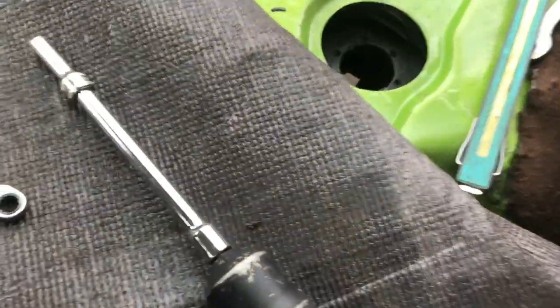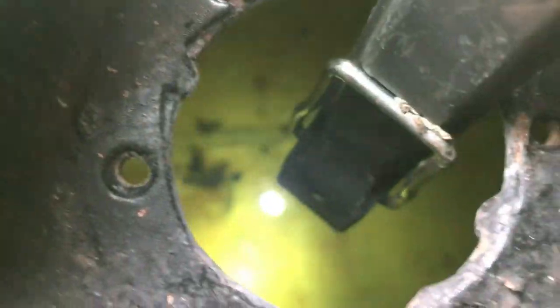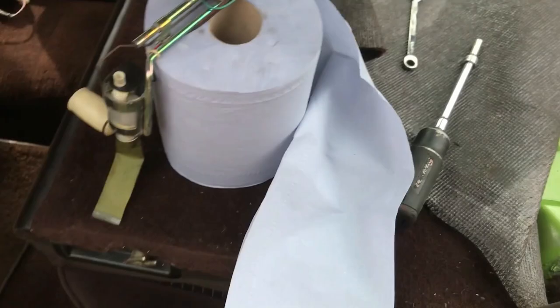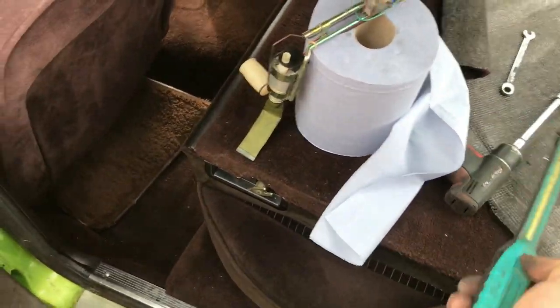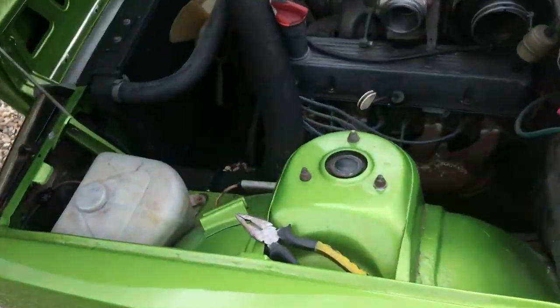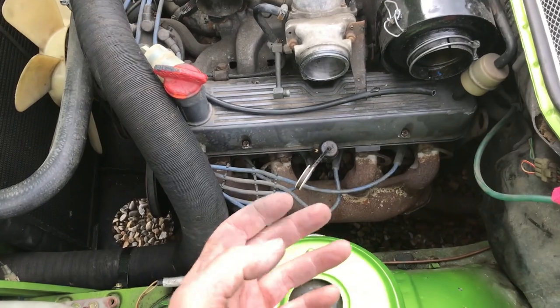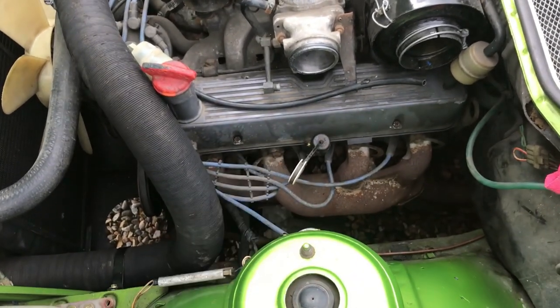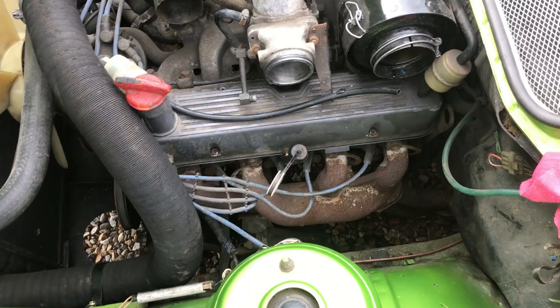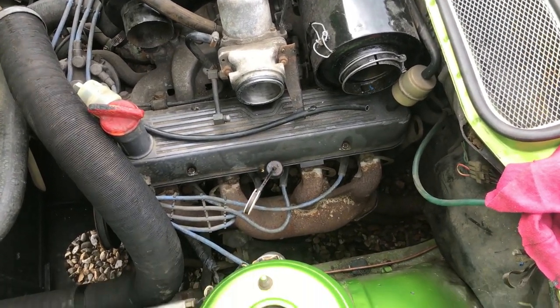If you've watched these videos before, this tank was completely flushed and cleaned out, but it was badly rusty. When my mate just pumped fuel out into the engine bay side, we put it into a little bucket and had a look, and you can see a little oily residue which almost won't dilute or mix in with the fuel — it just sits there. I think that is leftover rusty water from when I drained and flushed that tank.